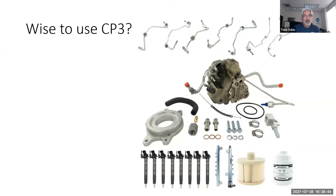I do believe you're stressing the CP3 considerably when you put it in a 6.7 — the pressures are high. Having worked with Bosch and seen what these pumps were designed to do, when kit sellers say "we updated it," what can you really do? You'd have to modify everything on that pump. That said, the new 2021 6.7 left the CP4 and went back to the CP3 — but Bosch tells me it's a CP3 on steroids, meaning it's been updated.